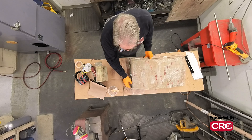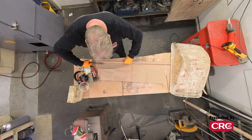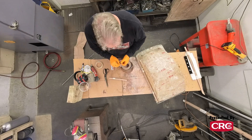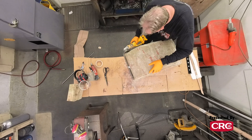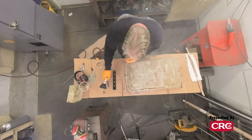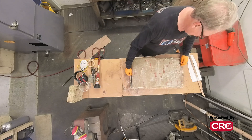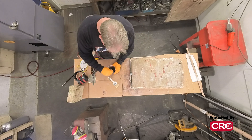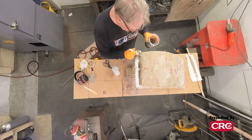Our next steps are to build a channel on this side and mount our upper bracket in. This is the way you make a channel — I've rolled up some cardboard and some brown paper. If you look at a car like a Lotus made of fiberglass or a TVR, and you see a channel like this, you'll detect that's how they did it. You don't want to just fill this with resin and fiberglass — it'll be ungainly heavy. This paper channel can stay in here forever; it's not hurting anybody. By the time you put glass over this, it will make this very strong.